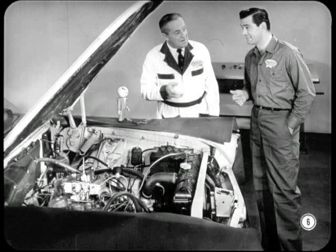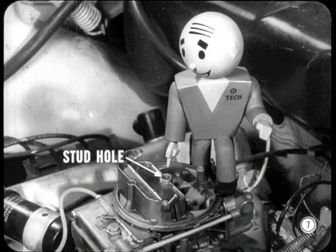Maybe one reason you couldn't smooth out the idle is you couldn't find the bypass idle airspeed adjusting screw. It has the same effect on idle that you get by adjusting the idle speed adjusting screw on other carburetors. You win the cigar, Chad. Now, whereabouts is that airspeed screw? Here it is, Brady, down inside the air cleaner's stud hole. You'd better use a narrow blade screwdriver to adjust it so as you won't damage the stud threads.